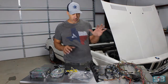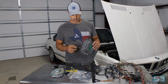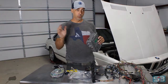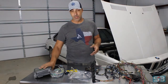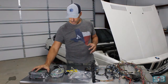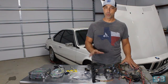Now that we have the hardware modifications done, I want to walk you through what's required for the wiring before we end this episode. One thing to mention — I'll have to keep the original ECU unit installed inside the cabin underneath the glove box. One side is the ECU engine control unit, and the other side is actually ABS, so it's got its own power and ground. I removed the old ECU connector — it's in the trash — but I do need to keep the ABS side, so I will be installing it back in the car. If your unit has ABS and you want to keep it, you'll need to still install the ECU unit back in, even though it's the ABS control side, not the ECU side. For the wiring loom I'm putting together, I won't show the details — I'll be putting that together off camera. It's going to take a long time: writing it down, drawing it out.